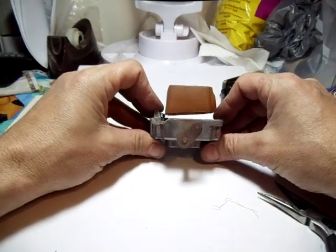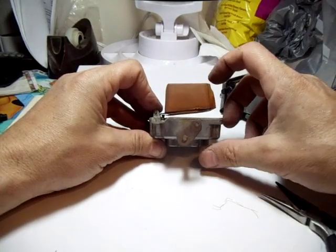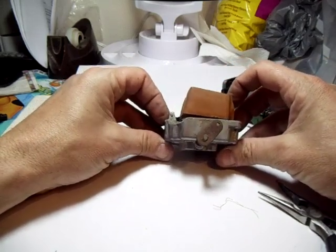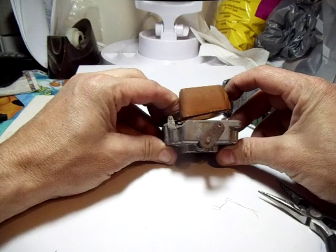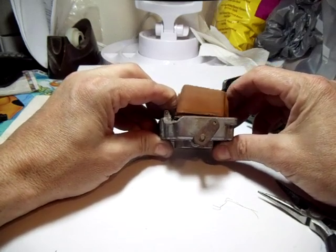This looks good if you look at it — it looks almost right. I don't have the gasket on here, but there's supposed to be about an eighth of an inch from the gasket up here. There's that eighth of an inch, but there's just so much flexing. There is no real home base — there's that much flexing because of that crack. And it's usually worse when it's wet with fuel.